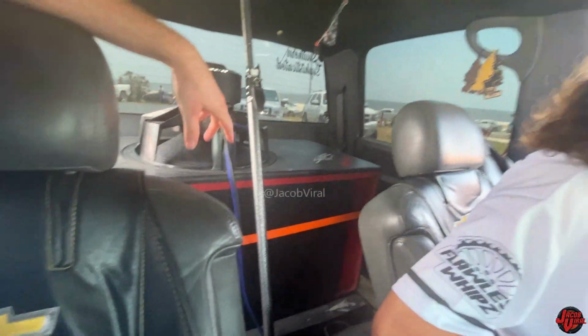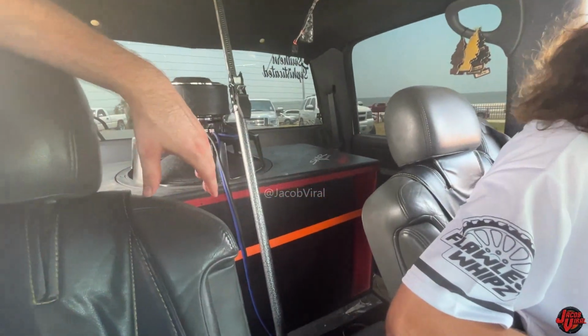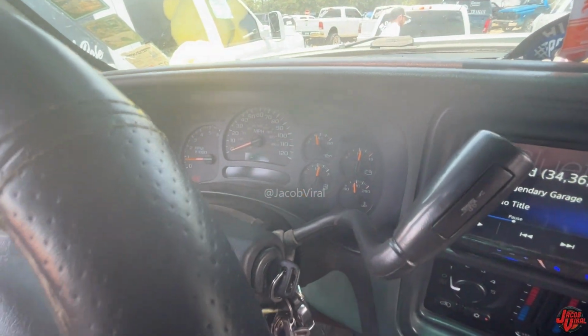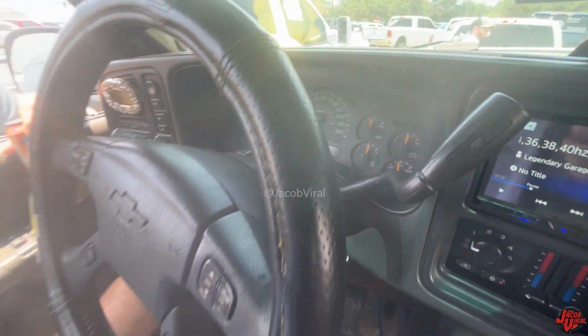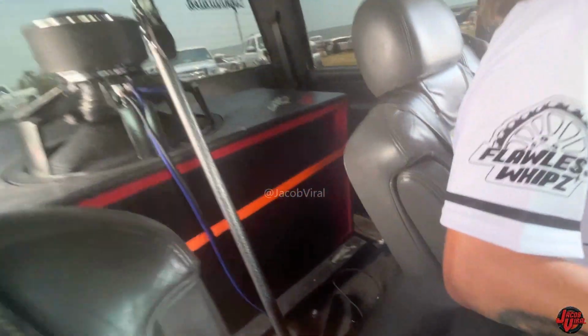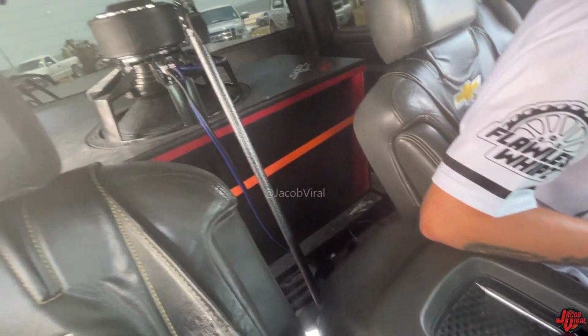So you said you're going to plan to upgrade your alternator because your voltage dropped bad. Do you have a voltage reader to kind of know how bad it was? Probably goes from about 14.4 to a little bit under 10. Really? 10s? Oh, yeah. Once you do the alternator, it'll help. Or if you do a second battery, it'll help too. Yeah, I thought about that. A battery would probably be more beneficial for battery reserve, but that's up to you. Yeah. Thanks for the demo, man. No problem. I like it. Yes, that's me. You can see my face right there.